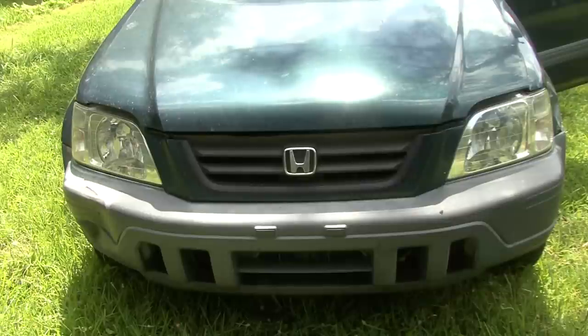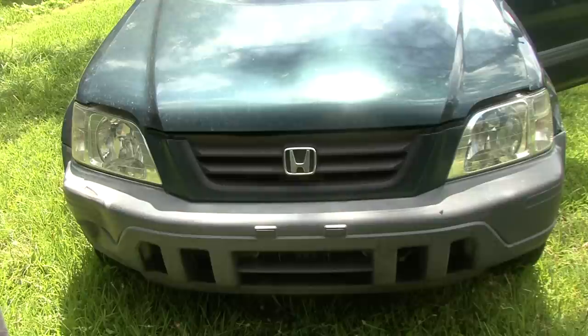Welcome to 1159 videos. Today we have another 1997 Honda CR-V with a D4 flashing, which is the P1758 — the lockup solenoid fault B code. We're going to pull it out, change it, and see if we can clear the codes to determine if it's the computer, after we change out the lockup solenoid.